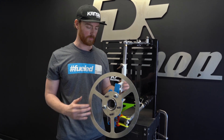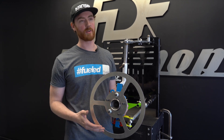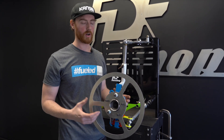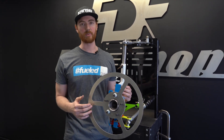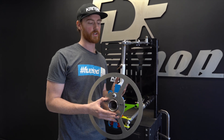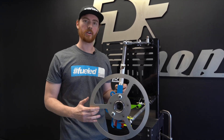Basically camber is relatively simple — the complicated part is showing you that you can get camber through three different methods of adjustment, and understanding that is super important when it comes to drifting. To close on camber: there is no perfect or right way to do it when it comes to drifting. In grip driving there is a right way. With drifting there are so many variations — tire compound, rear setup, weight balance, weight distribution, slip angle, tires wearing down and constantly changing in grip level as temperature goes up and tread wear goes down — so many variables.